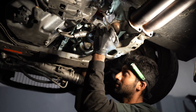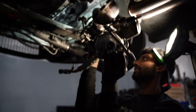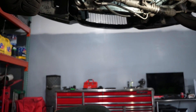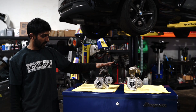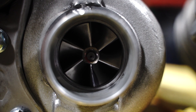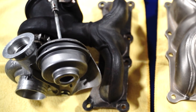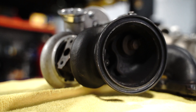Oh, looks like we got two of them. Oh they're so cute. Look what we found — Nate found some turbos! So I figure we'll walk you through a couple of the common options that pure turbo offers for the N54 BMW engines. Over here on your left-hand side we have the Pure 600 option, which comes with an aftermarket cast manifold — obviously much bigger wheels, able to make quite a bit more power than the factory setup. They are made overseas and use some overseas components to comprise the final product.